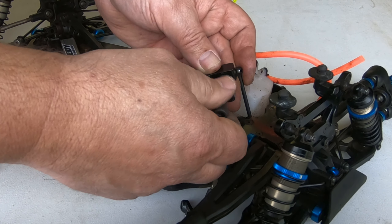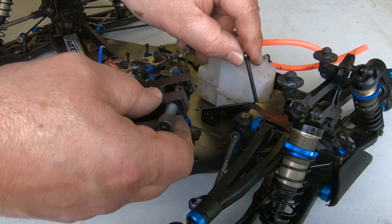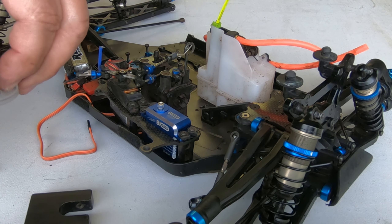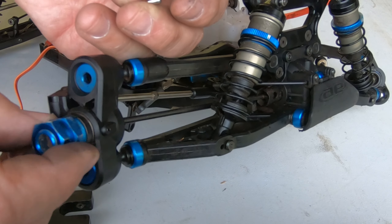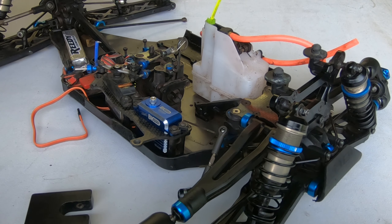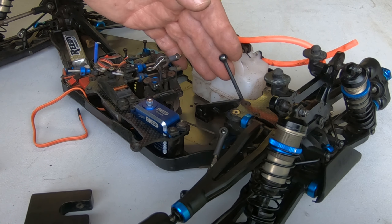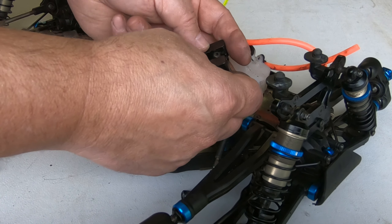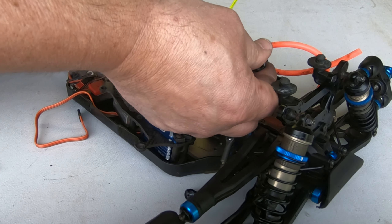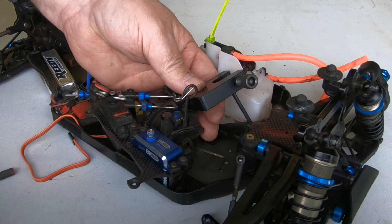I got that pin in there. Sometimes it's a good idea to use some red Loctite - it depends on the fit. If it doesn't feel super tight, a little red Loctite wouldn't hurt. I just take assorted pins - this one's 3 millimeters. These are actually pins for the out-drives with a 17mm hex and I just grind them to length, the same as the old one. Or you can just use a regular dowel pin steel - you wouldn't use stainless steel. Some companies will sell them in kits. This is nice because you can do it right in the car without taking the whole front end off.